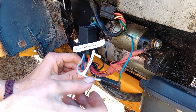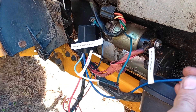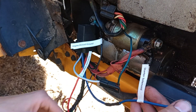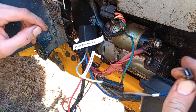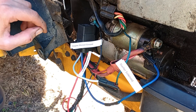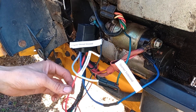After those two are connected, the next one will be your starter solenoid wire. This is going to be the new power wire that runs your starter, and it will be coming from the relay instead. This is basically just about the same style as the original, just a different series of connector — plugs right into that tab right there. Your tab may be oriented a little differently, but that's the same.